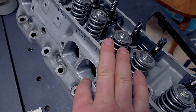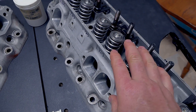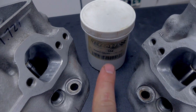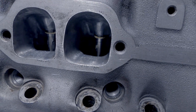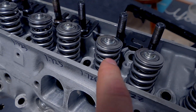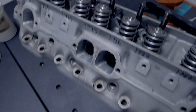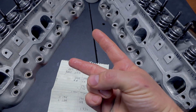Another thing: when you're putting these guys together, a lot of people just use oil — they'll put them on the seals, down the guide, then put the actual valve in there and assemble them. I don't like to use oil if they're going to sit for a long time. I like to use a good high-quality assembly lube. The reason is that assembly lube won't go nowhere — oil eventually, when it gets hot and cold, hot and cold, if it sits for a couple of months it's all going to drain past and end up in the bottom of your valve, not where you want it on the valve stem seals. You really want those valve stem seals on startup to be well lubricated, else you burn them up and then you'll have oil leaking past them and your car will smoke. So I think this setup right here has worked pretty good. If you guys enjoyed this video, subscribe, give it a thumbs up and peace out guys — see you next time.